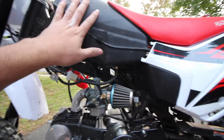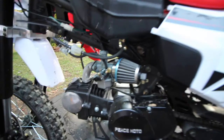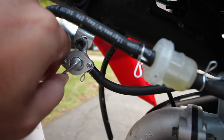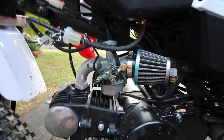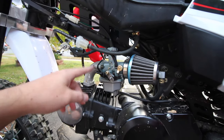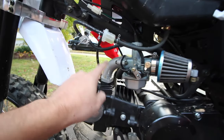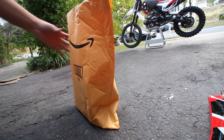You don't have to take the plastic off, it just makes it easier on this bike. First thing we want to do is turn the fuel line off so gas doesn't spill everywhere. Even when we turn it off there'll be some leakage, so we'll need a water bottle or something to catch it. Let's open up the new carburetor box and see what came inside.